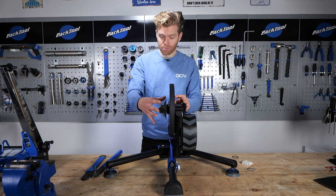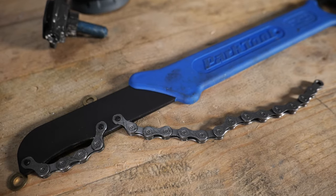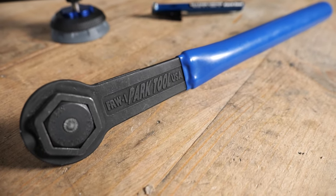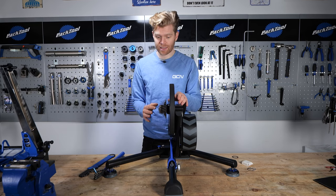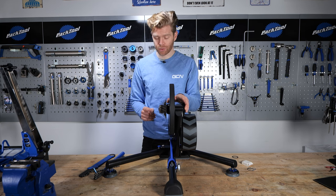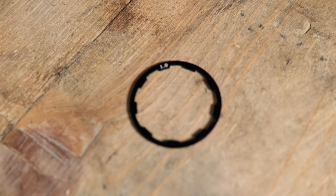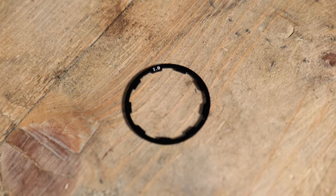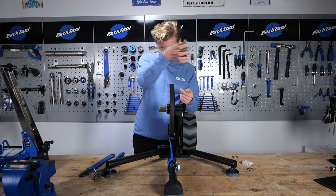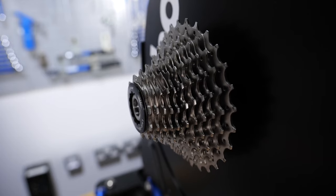Simply, all you do is remove the cassette from either the trainer or the bike using a chain whip. Here's my trusty Park Tool chain whip and a cassette lock ring tool and a wrench. That's a pretty straightforward thing to do. We've got videos that show you exactly how to do that — they're essential tools that I'd recommend every cyclist owns: a chain whip and a lock ring tool. Then with the cassette removed, you can simply apply spacers on the end of the cassette. We position the cassette with spacers more outboard because that's the only way you can go — you can't force the cassette further that way against the end of the free hub body. You can only put spacers on to move it outboard.